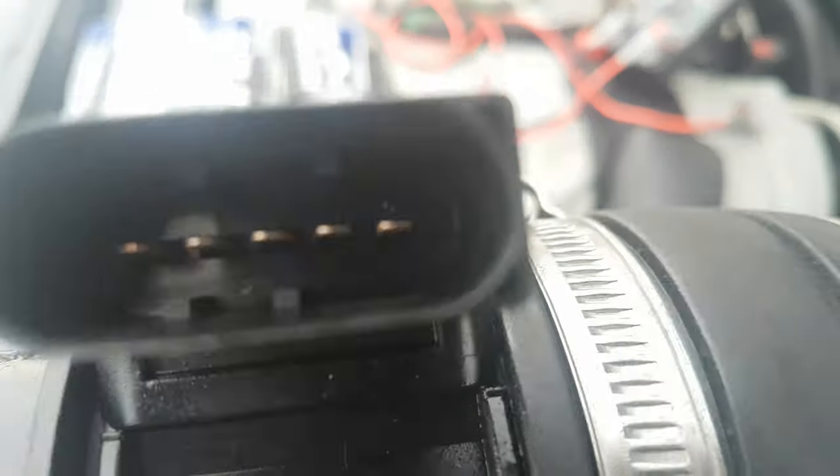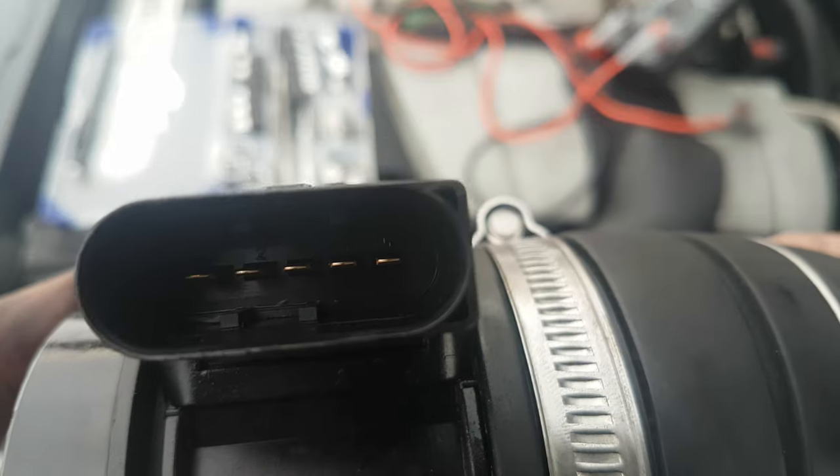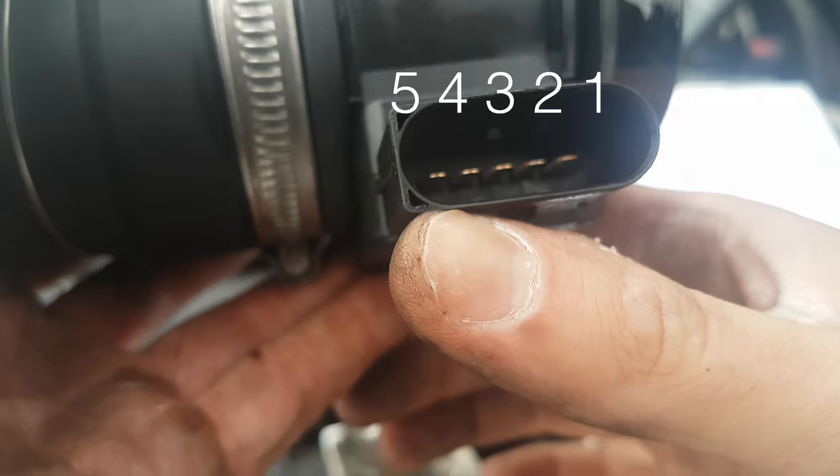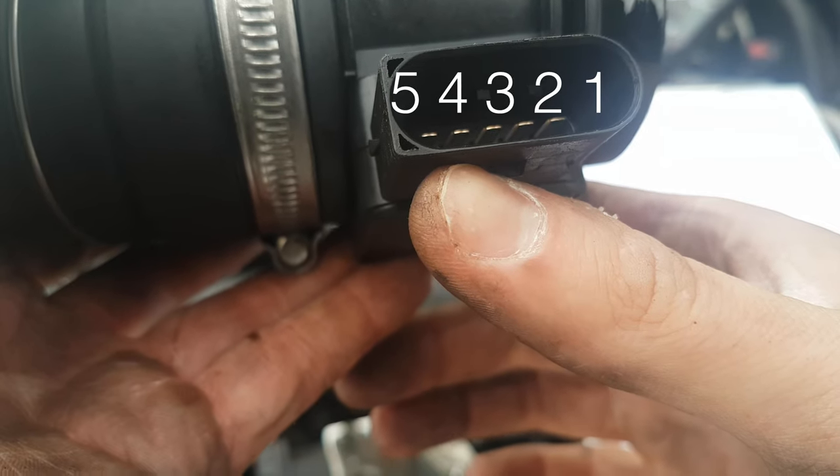So if you have a look inside, you will see in the middle right there there are 2 hot wires, and then down here you've got the intake air temperature sensor. The hot wire will typically sit in the middle. As you can see, you've got 5 pins which are numbered. Pin number 1 is the signal wire for the mass air flow sensor. Number 2 is the 12 volt supply, responsible for keeping the hot wire at the correct temperature.